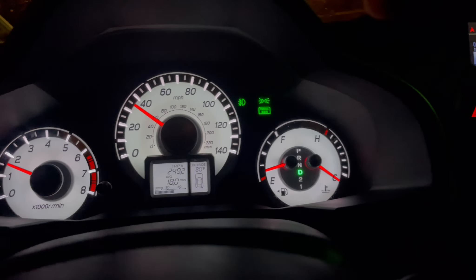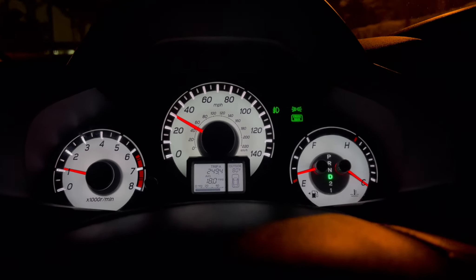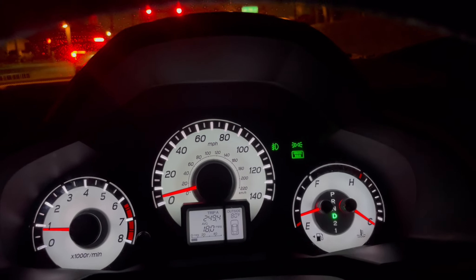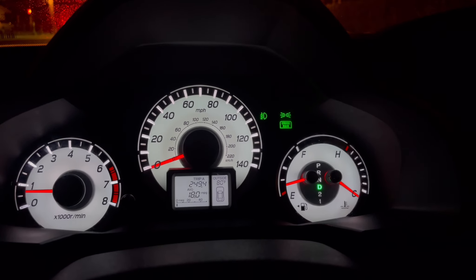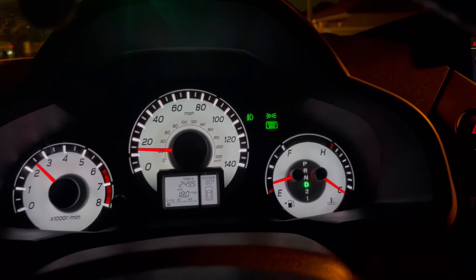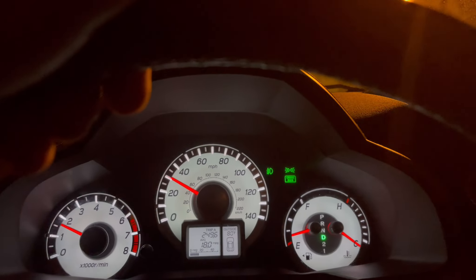But even after clearing the codes, now it's reading cold — just straight up cold. The car's running fine. We maintained the car pretty well, but at first it was registering too hot, so the car would kind of stutter and almost feel like it was going to turn off. Then at some point the battery died, and I changed the battery, and it really hasn't been the same ever since. I ordered a new sensor, replaced that whole unit, and everything was fine for a minute.